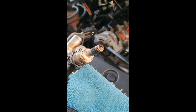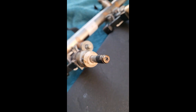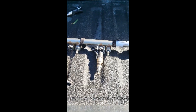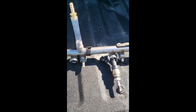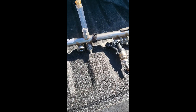The passenger side fuel rail has been removed — they're extremely dirty. That's the one that was stopped up, causing the misfire on cylinder number six. I've placed rags into each of the eight intake holes. Inspecting the fuel rail on the back of the truck, I accidentally pulled one injector that didn't need to come out — only the bad one needed to be removed.